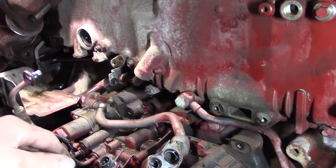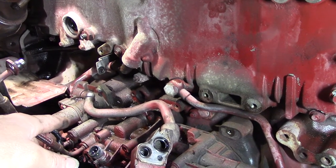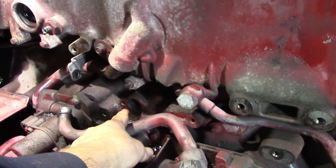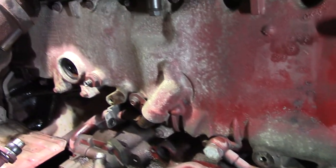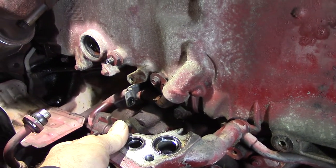The coolant line is in the middle — that bolts from underneath. That fitting won't come out either until you remove the turbo, and then it just pops out. There's no clip or bolt or anything that holds it in. It's really just when it's bolted to the turbo that it stays in there.